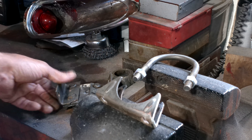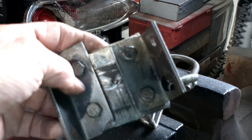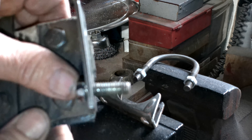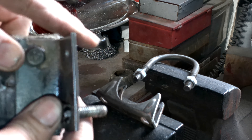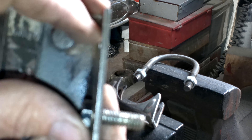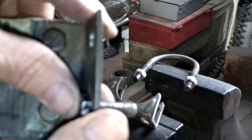So they're going to have a stud. These are original Studebaker hangers - pretty good shape. You can see some of the original black paint on there and some of that red primer they used in the factory. You can tell they've had pretty good storage. This is where they thread into the frame - actually thread into the frame on these. The frames are so thick it's actually just drilled and tapped. One side didn't have original bolts, the other side is original, and one of them was stripped in the frame - no big deal, just put a nut on the back side.